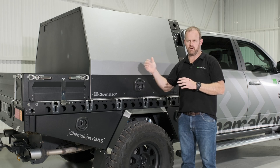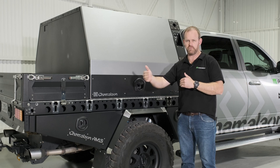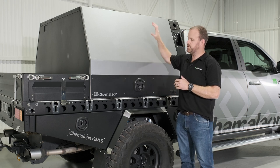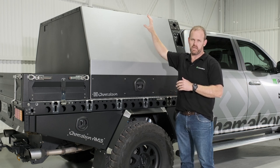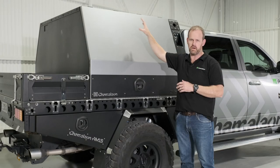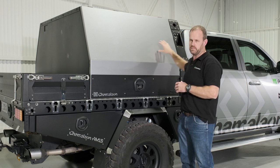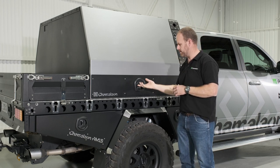The locker going 3.5 is three and a half of our pitch count — 350 mils times three and a half. We don't have a roof rail kit option on this one, but it can be bolted on; all our lockers are constructed ready to accept those roof rail kits in our variety of roof structures. The door here has been two-pack painted to match the car — powder coat is standard across the range in a variety of colours.